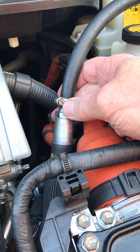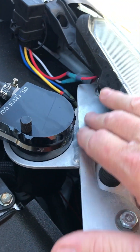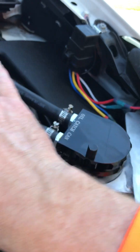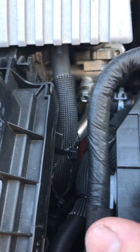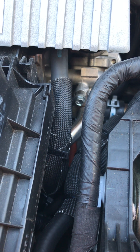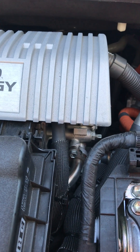This holds the original Toyota-style PCV valve — it's something I TIG welded quickly. It's got a half-inch fitting on the bottom, going from half-inch down to three-eighths. The three-eighths feeds back into the catch can, and I TIG welded a little bracket. Three-eighths out goes back in and feeds down into the intake manifold, which has a horseshoe-shaped hose.